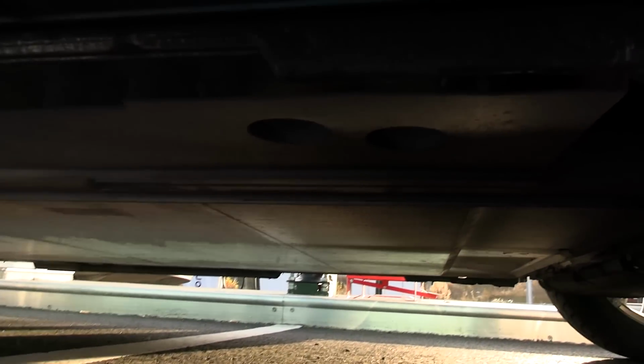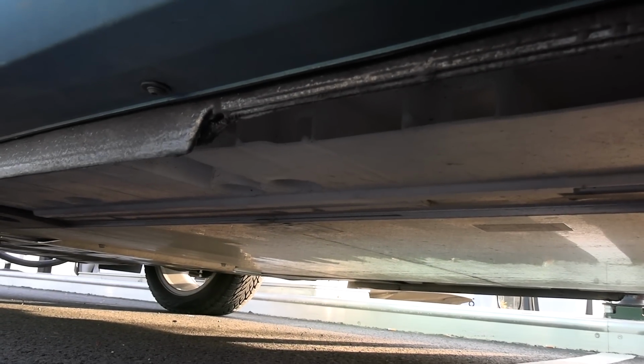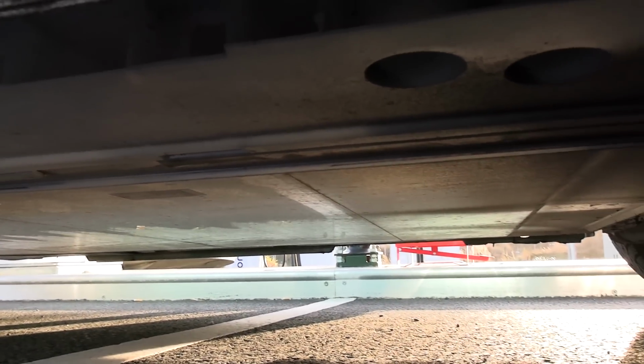That makes me believe that the battery might be too cold, because I've seen in the Model 3 that the battery is maintained at around 25 to 35 degrees Celsius, but it's getting lots of help from the drivetrain. But in this car, it might be as low as 10-15 degrees Celsius. Also, I don't know if the battery pack here has any insulation. We can check out under the car, by the way. Yeah, let's do that. Okay, let's go. We're charging it anyway. Well, you see there, we have the battery pack under here. There's some stuff, there's some metal. I don't know if there is a layer of insulation here to actually keep the battery nice and warm.